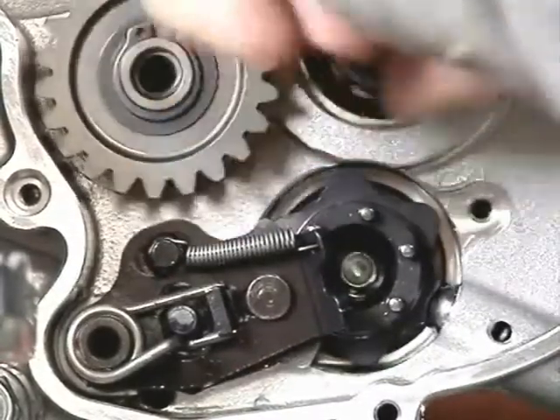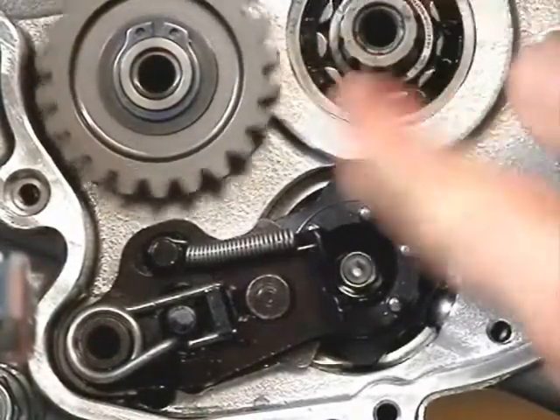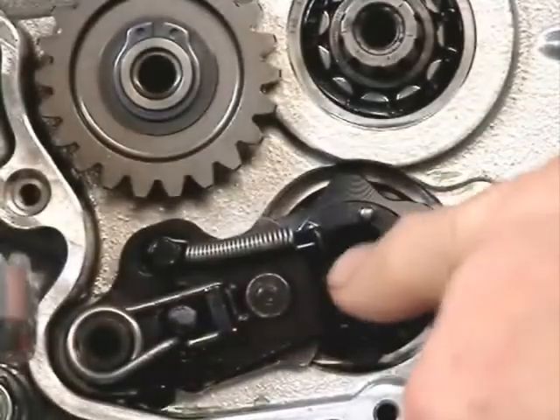In this movement I have moved it back to neutral, and you can see I can move the transmission shaft freely. We're in neutral — a small ball right there has a spring behind it that falls into a little slot.